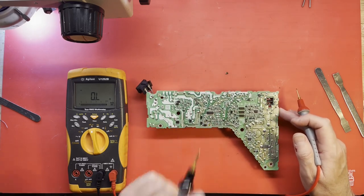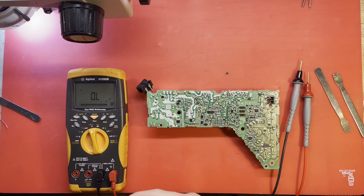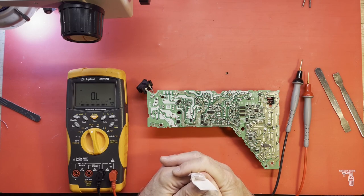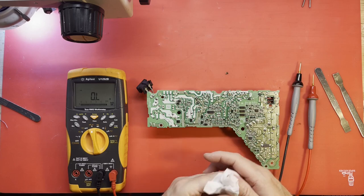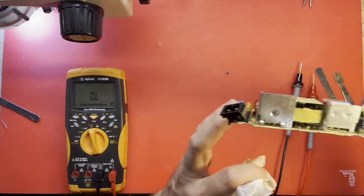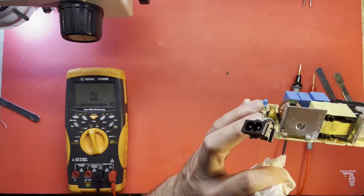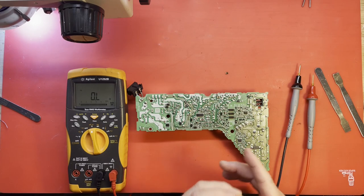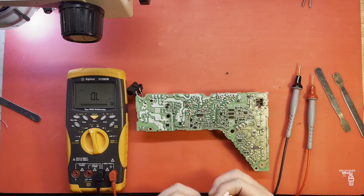And possibly the DAP-53 that drives said MOSFETs. And I cut myself getting the case open. Do these MOSFETs just blow on their own? I kind of doubt that. Are both of them identical? 18N60M2. I do hope I ordered some of those. That's the place to start — we'll get those MOSFETs out and see if that's the only thing shorted.